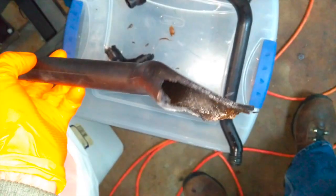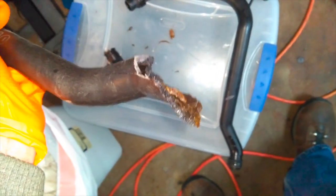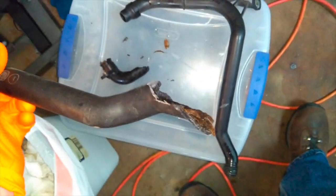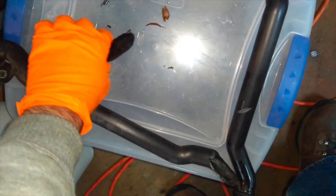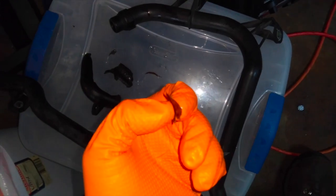People who've had their pipes on longer, or whose pipes have gone under more stress, sometimes observe that the whole pipe, inside and out, is that peanut butter color, and it just sort of breaks off. I don't know which is easier to remove, a peanut butter pipe or one like this. But what I do know is that you do have to get all of it out. Here's part of it. Try to reconstruct it so that you get a better idea of what's left inside. You can see a lot of bits, and here's some of that peanut butter film from the inside of the topmost pipe.